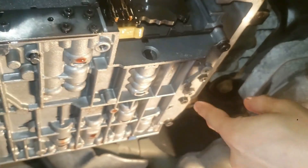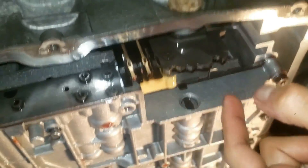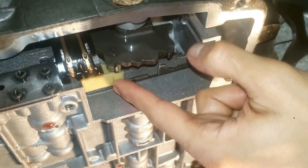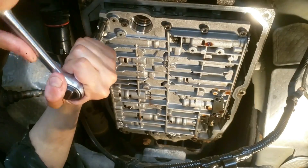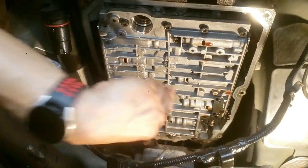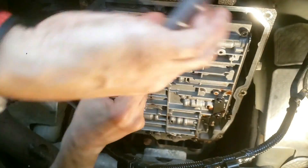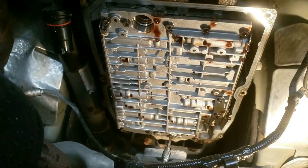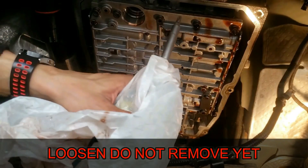What I'm going to do now is remove some of the screws at the back and some of the others as well. The purpose is to loosen so I can pull this out a little bit without removing the entire valve body. Like with removing the transmission oil pan, I'm going to lightly crack loose all 11 of these valve body screws with a ratchet and Torx T30 bit, then switch over to a power drill to be faster. Just loosen the T30 screws — do not fully remove.